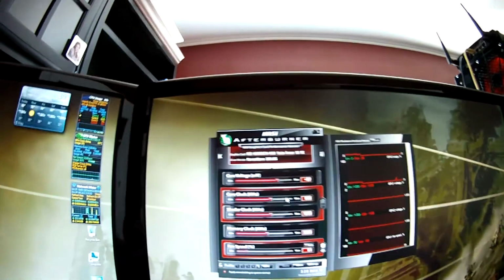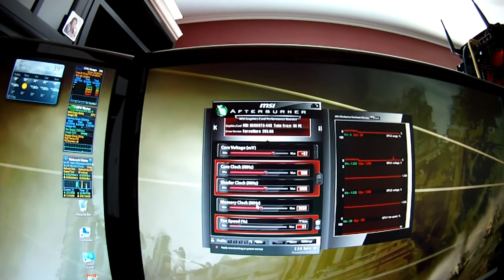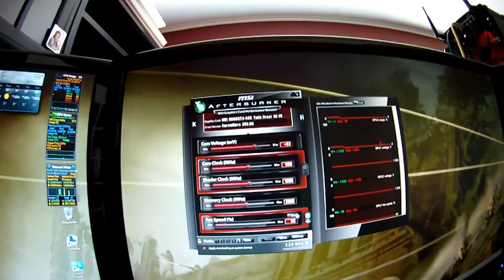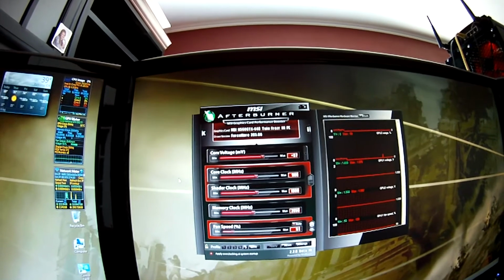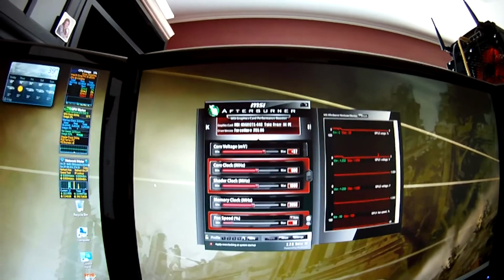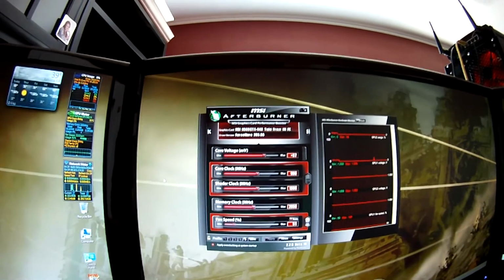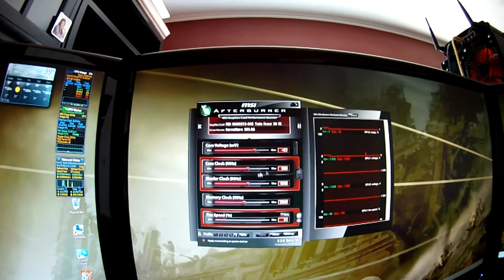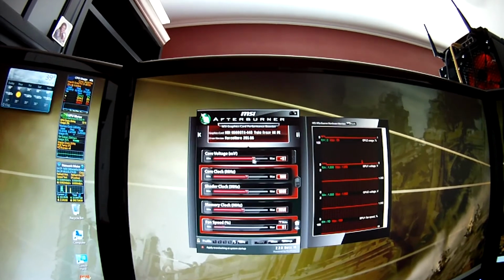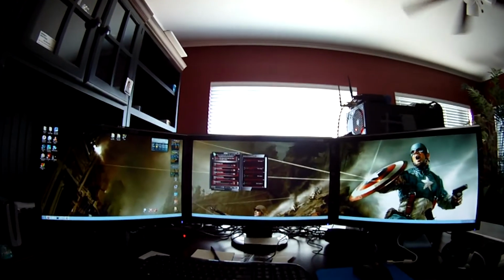By taking it up this high, to this much of an overclock, it does quite impressive with both cards. I mean, quite impressive. When I had just the one card, I had it at 925, I think, by 2100 or something right here. I was benching on 3D Mark 11 into the 580 levels when I compared them to people on the overclocking forums that I'm on. Their stock scores, I was either able to keep up with them or even beat some of them with a single card when I had it overclocked. Since I'm running both of them, I took it down a little bit because of the heat. I'm not running as much voltage, and I think I can actually even go down a little bit more. So that's my setup for now.